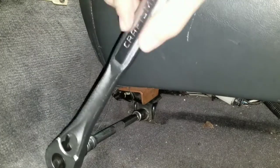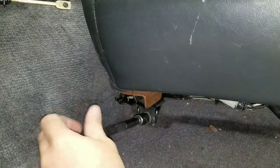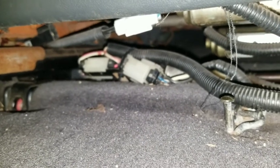Another thing you need to know to get this seat removed: there are two bolts up front and two nuts in the rear. Also, there are a couple of connectors on here — you can see them right there — that's for the power of the seat and the seat belt sensor. You'll have to remove those too, but that'll be easier to do once the rear nuts are taken care of.